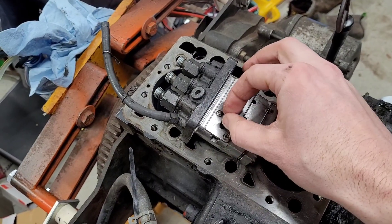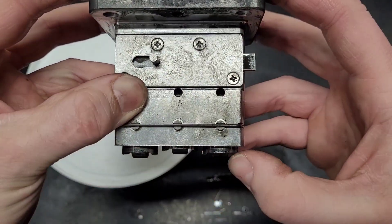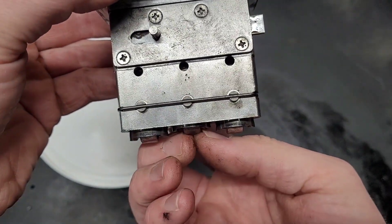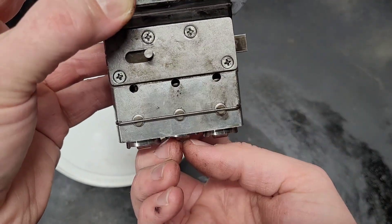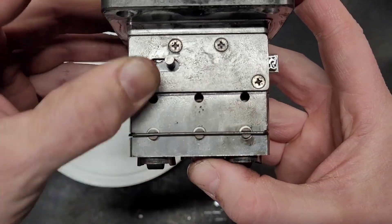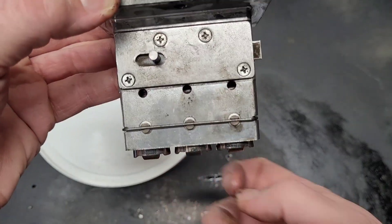Guessing that's the rack — it was tight and now it goes loose. In cylinder one, that feels good. Spring feels good, action feels good. Cylinder three feels kind of weak but something's happening. And then in the middle cylinder where I wasn't getting any fuel, the spring is — maybe the spring is broken. Nothing's happening, it just jiggles loose there. I think I might have figured out why the fuel rack was getting stuck — I noticed that when this one's pushed up, the rack actually gets stuck. So that's probably why the rack kept getting stuck. Let's take it apart and see what we find.